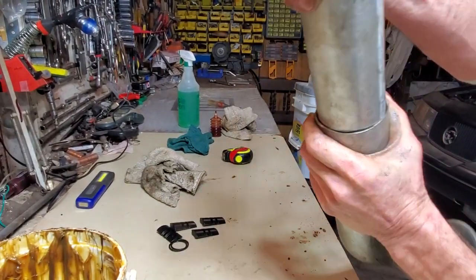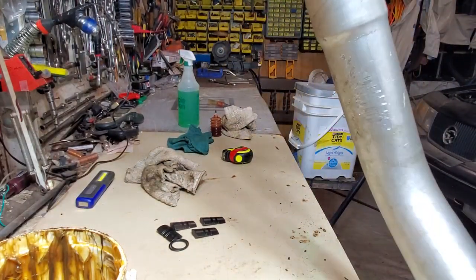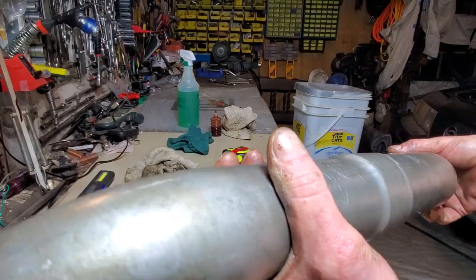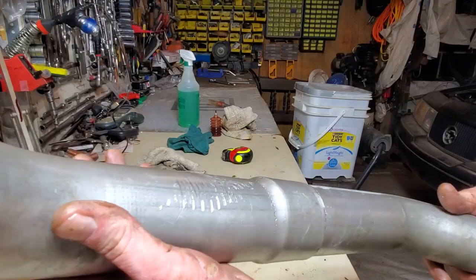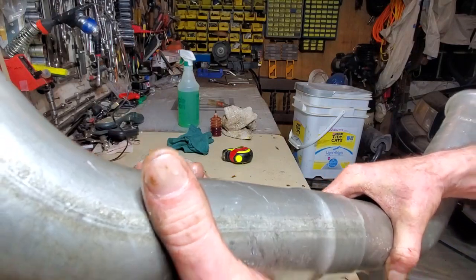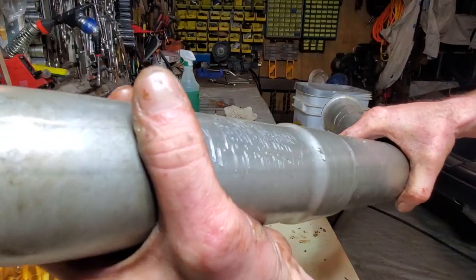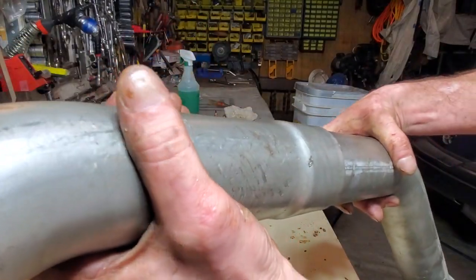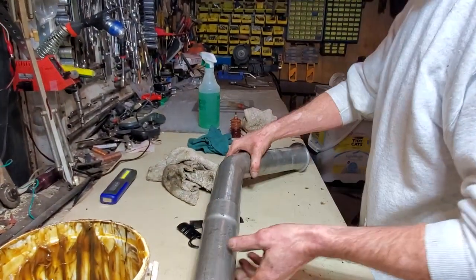And not a bad looking coupling. Flare looks pretty decent. I was just being real tedious with it. While it's on your vehicle, look at the light, it can tell you what it's doing. You can see that rotating the die around in different spots levels out the stretching of the metal. Not too shabby. I like the tool a lot.